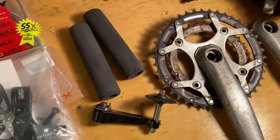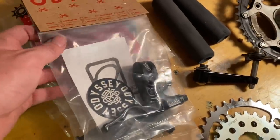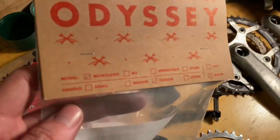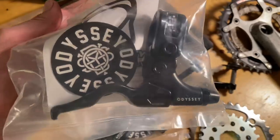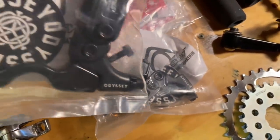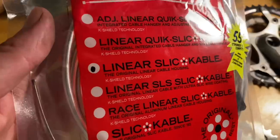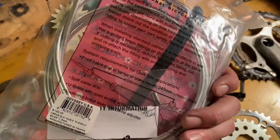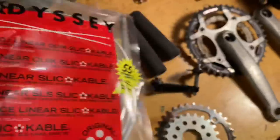I'll also have a chain tensioner if I need it, and some ESI chunky grips — I really like these, they're left over from another build. For braking I'm going to use Odyssey brake levers, which are a BMX brake lever. I can use these with cable brakes that have road pull, because BMX brakes have the same pull ratio as road levers as well as cantilever brakes. For brake cables I'll be using Odyssey linear cables, also called compressionless cables. These are the chrome items, so they look quite nice as well as being really functional. Linear cables help a lot with cable brakes — they take out that little bit of flex you can get when hard braking, making them much firmer than a coil-wound cable.